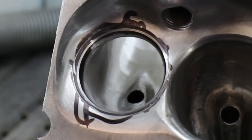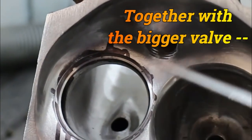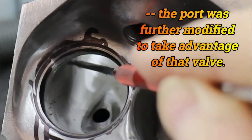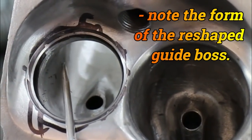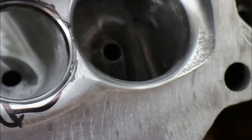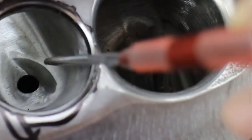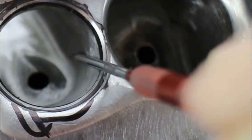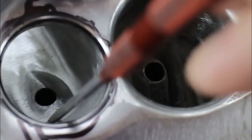In this shot you can see the valve seat — I've cut this just before I've got to the point of blending this top curve in. Also in this shot you can see how this is cut away; the flow predominantly is going out this way, so this needs to be cut away. Notice how the guide boss slopes and how small the guide boss has become. Let's turn around now and look at this side of the port. You can see that although there's a generous cutout here and the port's widened across here, it's not as much as on this side. This is the area where we have to be careful not to go through just here — that's about the limit.